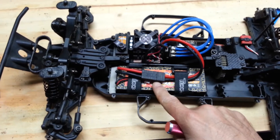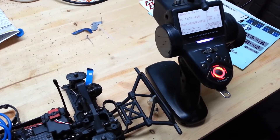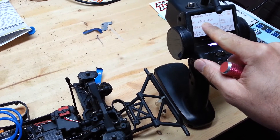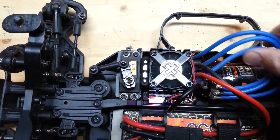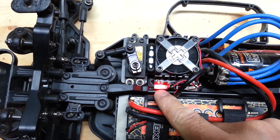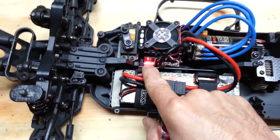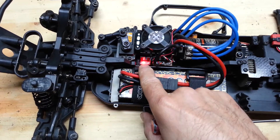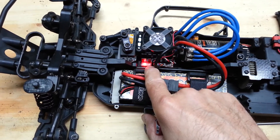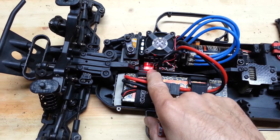Before you start programming, make sure your battery is plugged in and make sure you have your transmitter accessible. You want to turn it on and make sure that you're on the right vehicle. You turn the vehicle on, it goes through its warm-up light setting — a bunch of different lights — and now it's on a solid red light, which means it's ready to go. When you get your speed controller it will probably have the timing off; if the timing is off, the red light will still be solid but you'll get a flashing white light, which means it's in blinky mode.